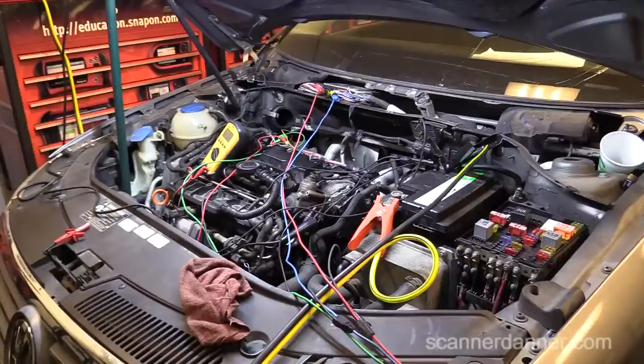That's what I think is the scenario, but I don't know. Without getting the computer fixed we can't really verify. We could spend time doing cam-crank relationships and verify the belt. But do you understand that I want the computer to work first? Actually, I take that back - if this is a customer's car, you would not want to sell them a $2,000 computer only to tell them later that the timing belt is off and the valves are bent.